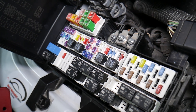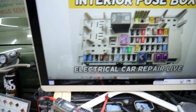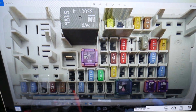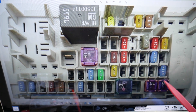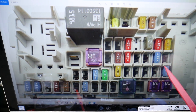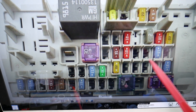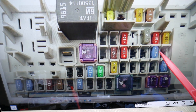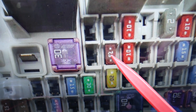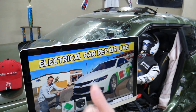We'll put a link in the description to a video that teaches you how to test fuses and check relays easily. Now, for the specific fuse — zooming in, you'll notice the fuses don't go in order, which is a little chaotic. For instance, it goes fuse one through nine, then jumps to 38, 44, 142. But the fuse you need is in that row: counting fuse number 20, 21, 22, 23, 24, 25 — that 7.5-amp fuse is the one to check for the data link connector. Hopefully the video was helpful — thank you for watching, see you next time.